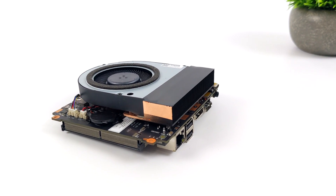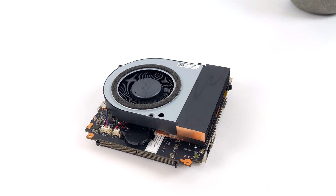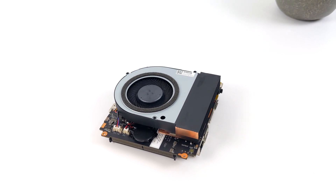I wanted to go a bit deeper and check out their new cooling system, because it is beefier than their older one — running these at higher TDPs requires better cooling. It looks like they have a beefier all-copper heatsink, sitting a bit taller with that fin array, and they've got a new vapor chamber system sitting right underneath the fan. In my testing so far, I've actually been able to take this up to around 75 watts without thermal throttling, which is pretty good for a small form factor PC like this.